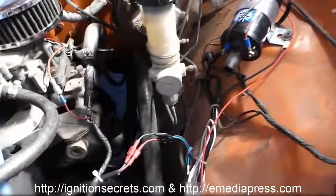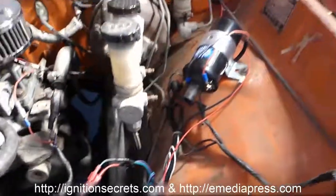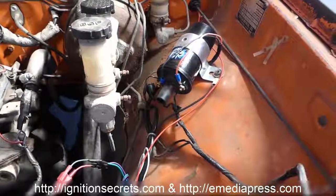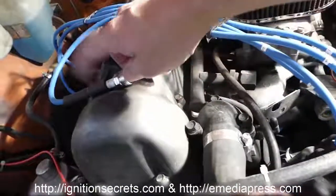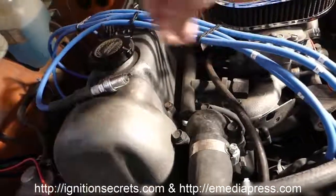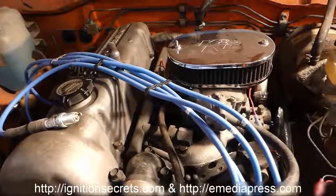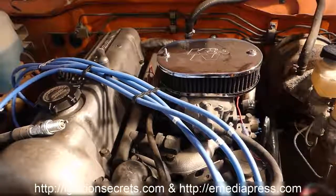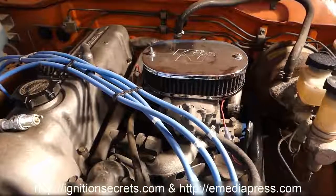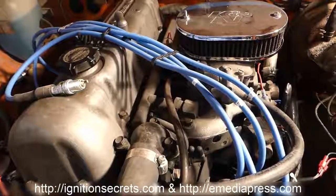And so what we want to do is be in contact with the positive of the capacitor, go through a diode, and the diode is going to be pointing in the direction based on what the high voltage polarity is, which I believe is negative, which means we reverse the diode, and then through the diode to the top of a non-resistor plug inside the boot here. And so when the high voltage sparks, that capacitor can actually discharge across the gap even if it's low voltage, because it doesn't see the resistance of the gap anymore, because the high voltage has ionized it and has made it conductive, and we get the hyperfast negative resistance effect where the capacitor has an accelerated discharge beyond what's normally possible.